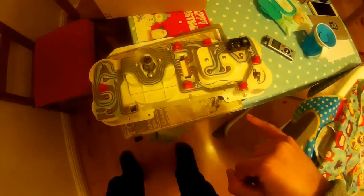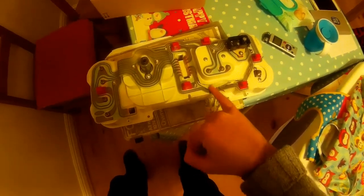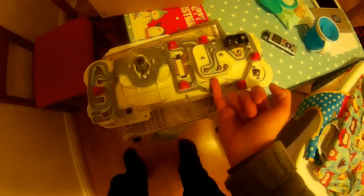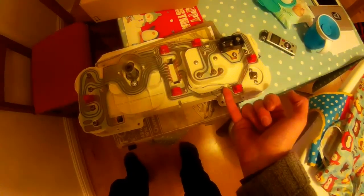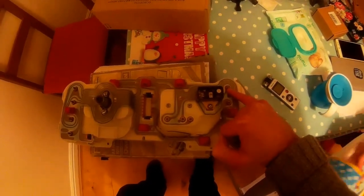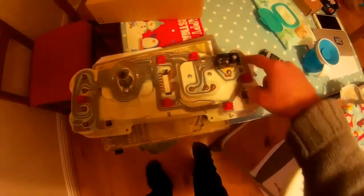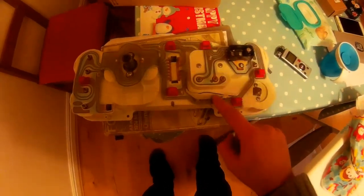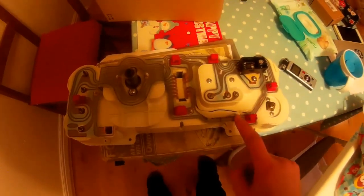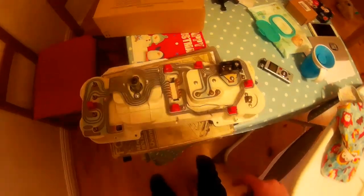An interesting thing I've noticed is that it looks like the wiring panel on the back of this has been on fire at some point. You can see it's all melted here, and this bit is almost completely burnt through, which is a bit worrying. Looking at the manual, this section is labelled as ammeter. I'm just going to cut this dead part out and replace it with a wire. I'm not sure what caused it, so I'm just going to tidy it up as best I can and hope it doesn't happen again.